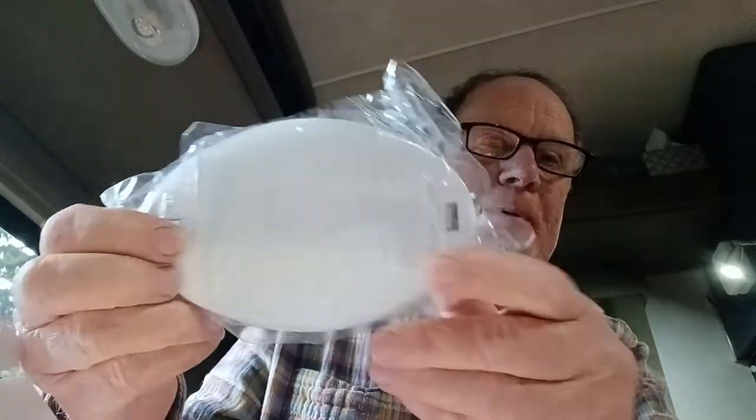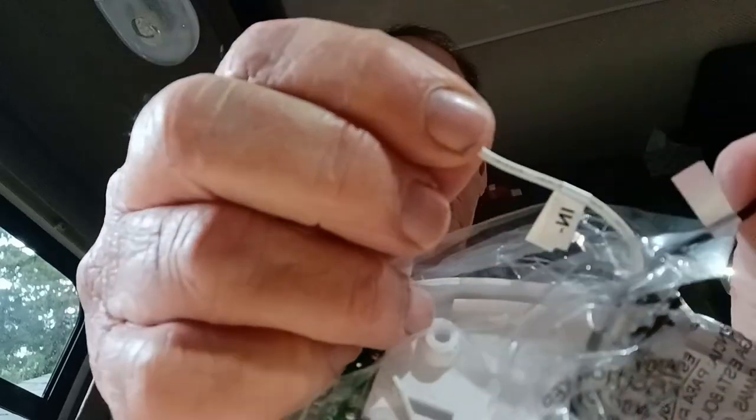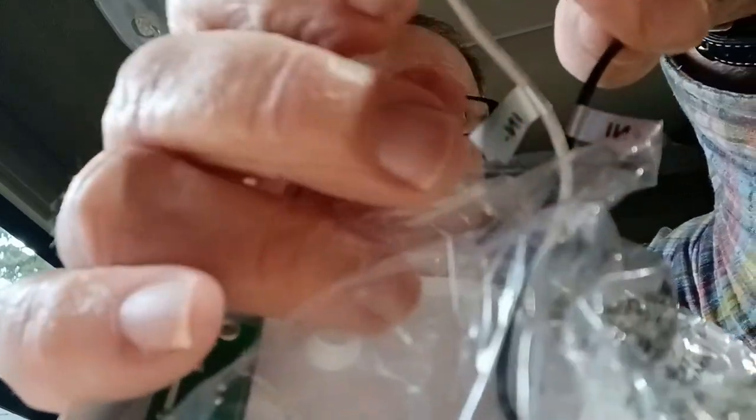This is made in Vietnam and distributed by a Chinese company. It's 12-volt DC. It comes with a light and switch. Best of all, it has USB — it's a high-speed USB charger, 5 volts and 2.4 amps, which will charge most things you have. It also comes with three screws and wiring. They mark the black and white wiring: the black is shown as positive and the white wire is shown as negative. You connect that to the trailer, which has red as positive and black as negative.